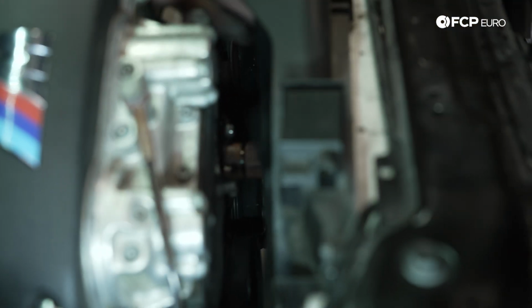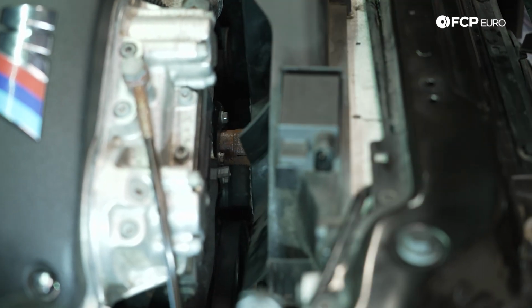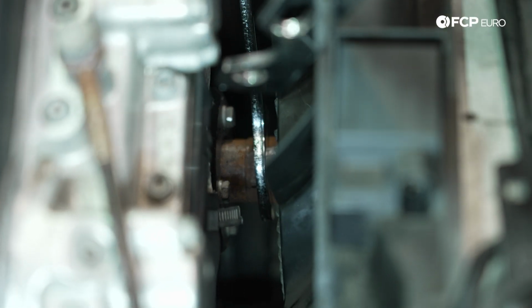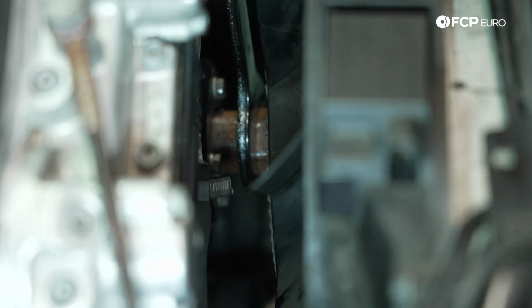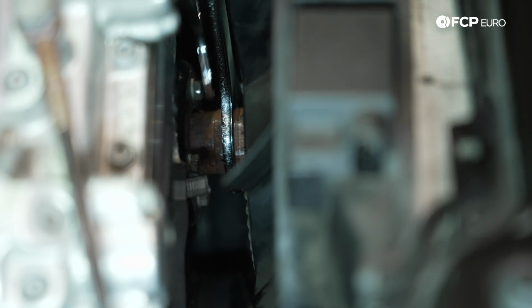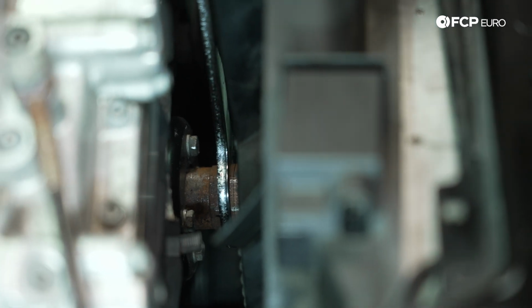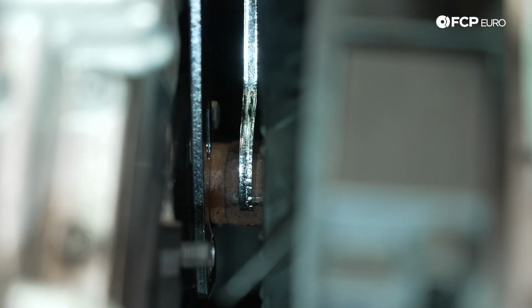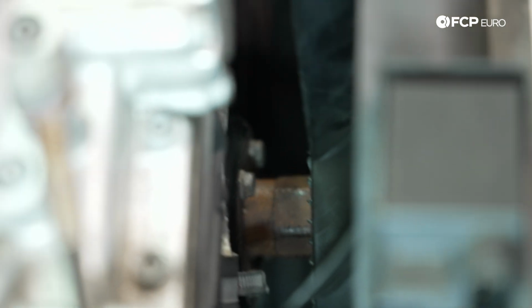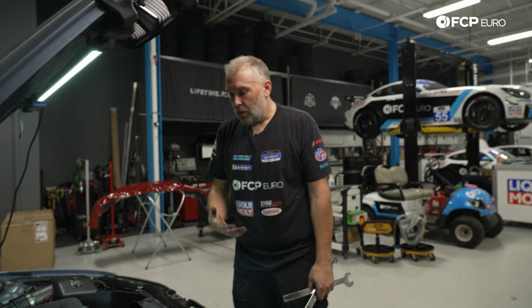We'll go ahead and thread our fan the rest of the way until it bottoms out on its own. And then we'll give it just a little extra persuasion. The nice thing is, being reverse threaded, it can't really come loose on its own. So you don't need to make it ridiculously tight, it just needs to be tight. Done. Just needs to be snugged up, don't go crazy. If you feel like you're about to stroke out or pull a muscle, it's too tight.